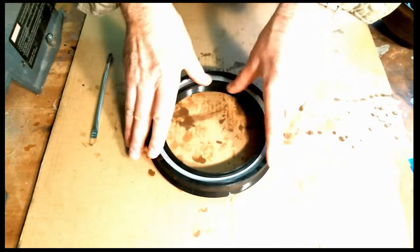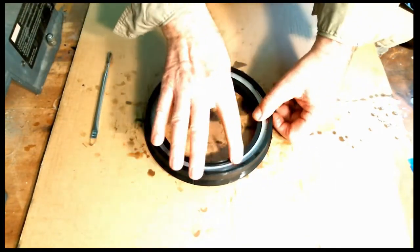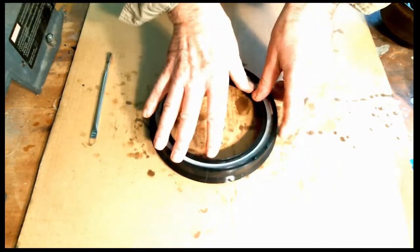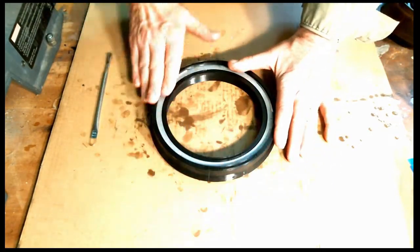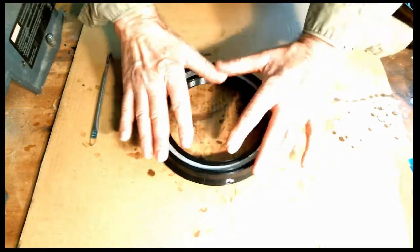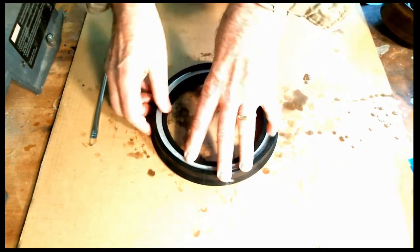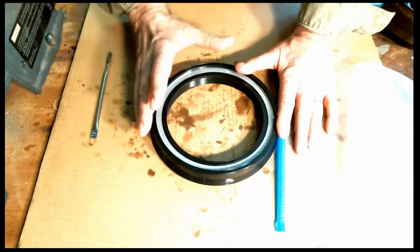And what you want to do is push it right down to where the tool will actually hit the table. And when it does that, you will see that the tool is almost flush with the back of the piston, but it'll actually be countersunk just a little bit. And again, you look at it real close, make sure that your outer tool is hitting those standoffs and that the inner tool is now just slightly below the edge of the piston. And in this case, we use another gallon bag and we put it in just like this, upside down.